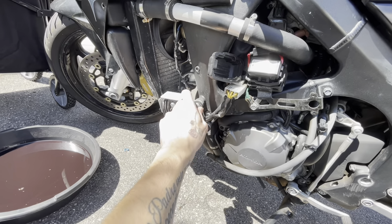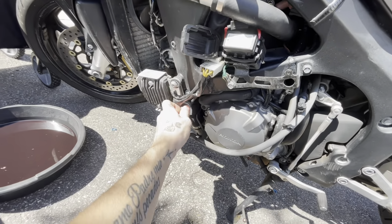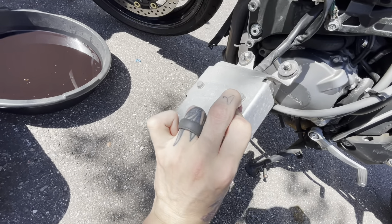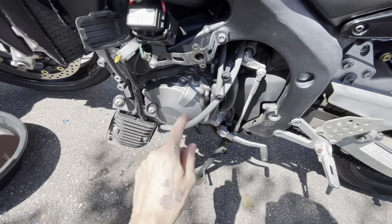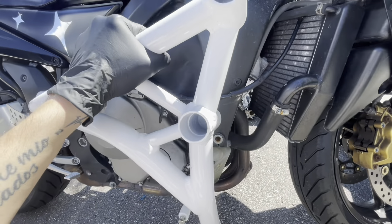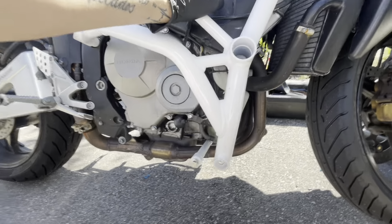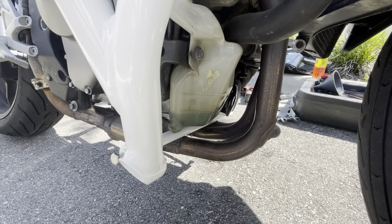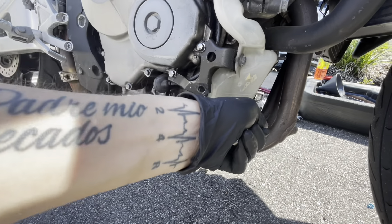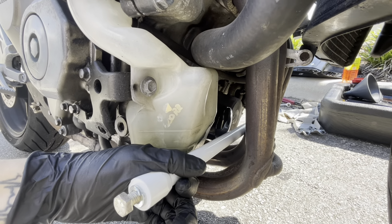Back to this — I'm going to go ahead and start on the cage stuff. I need to move the stator first. I took these bolts out already, they're hand loose. I have to take this plate off — I believe that's an 8mm, two 8mm bolts — and then I can probably zip tie the stator right here. With this side off, you can see the cage is going to go like that, and the reason I had to do the oil change is because the bar underneath is going to end up right there and I can't change the oil filter like that.